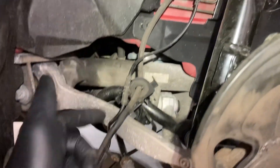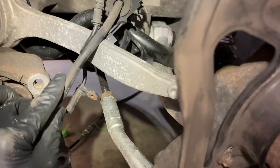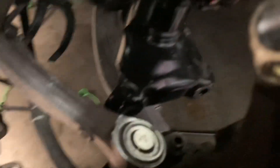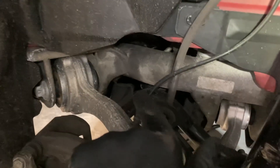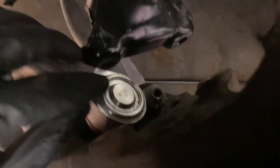Brake caliper and wheel speed sensor are moved up front where the line is not as stressed. The strut is moved out of the way and you can see the two ball joints — one points down, one points up. Keep in mind the strut is under tension from the rubber strut bearing up top, and the control arm bushing preload wants to push the knuckle up, so you're fighting those two forces. Going to undo the 21s and use the ball joint separator on both.